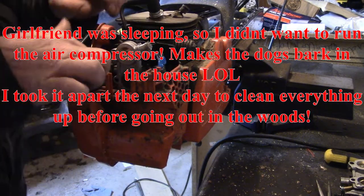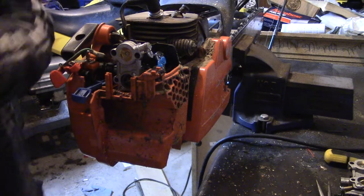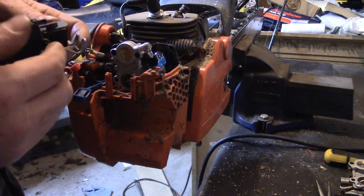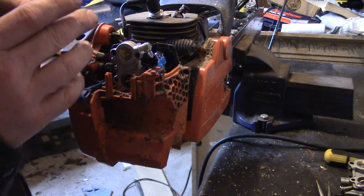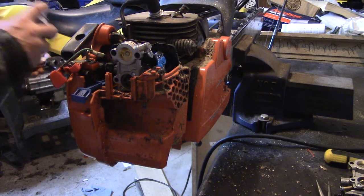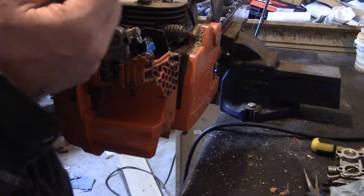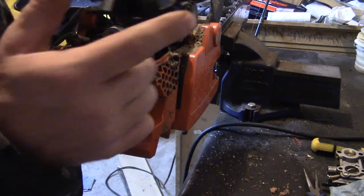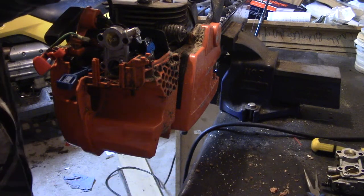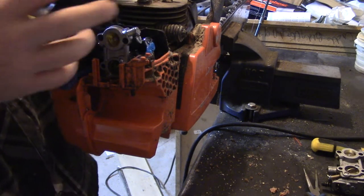Though. And now slide that rubber gasket over your adjustments. Now grab the plastic housing here. I'm going to spray this guy off. There's two rubber pieces here on the sides that these clip into. So you got to do that, and then your starter switch and your choke cable. I like to put this on first because it's kind of a pain in the butt.